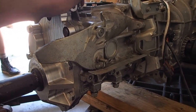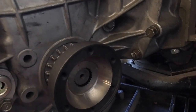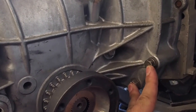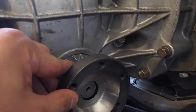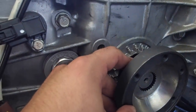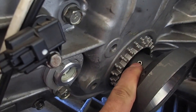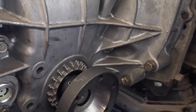Just some tips. We lifted it up, got it loaded on, and on each side of the motor and transmission there are these two bolts that go through the tranny into the engine block. But to get the bottom one in on both sides, we had to remove this little flange that the CV axles go on to. We had to tap out this little pin on both sides, remove that, put the bolt in really quick, and put it back on.